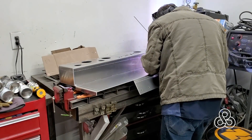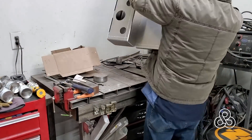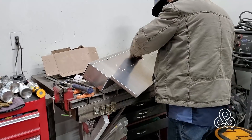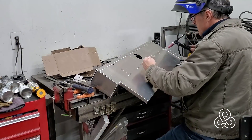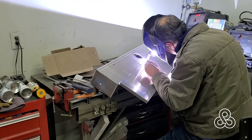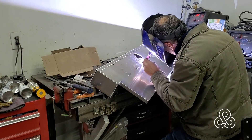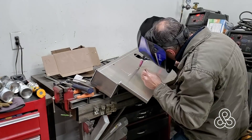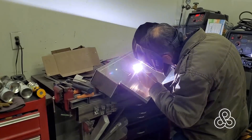I had a little bit of trouble with these welds, and I'm wondering if anybody out there has experience with this — I'm thinking that maybe the water jet actually leaves some of the abrasive embedded into the aluminum, because if I don't sand them out, they seem to have a little bit of a problem welding. If anybody knows anything about that, it'd be interesting to know in the comments. Anyway, we're going to go ahead and tack weld or weld all these tabs in here and get this box built.